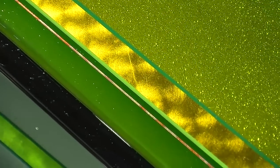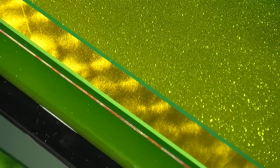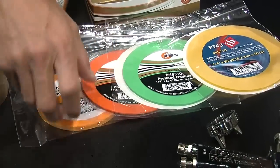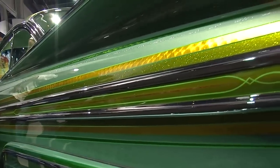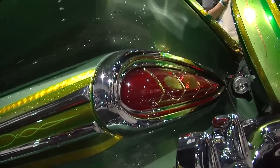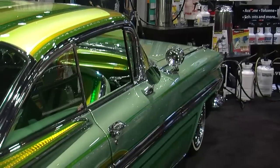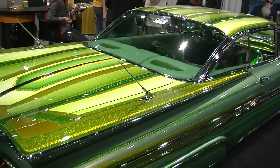What about the different colors — the yellow, the orange, and the slightly different color orange? The different colors each have a purpose. The green fine line tape turns a little bit more easily than the orange one. The orange one gets you straighter lines — you can pull like a long section, the whole length of an Impala, 20 feet, and it's not going to stretch or buckle on you. The colors also come in handy because if you're using different colors you can actually see what kind of patterns you're doing. If you're paneling out a project, you can follow that green line throughout the whole thing.